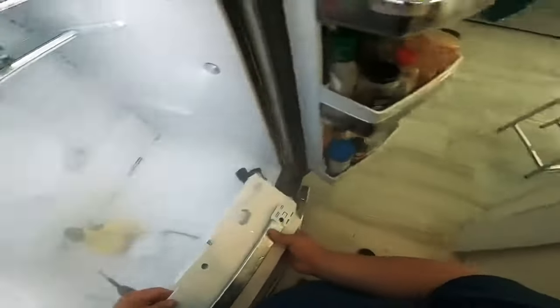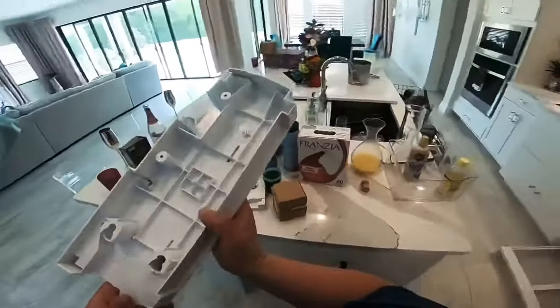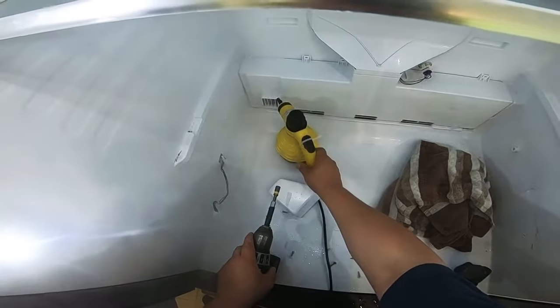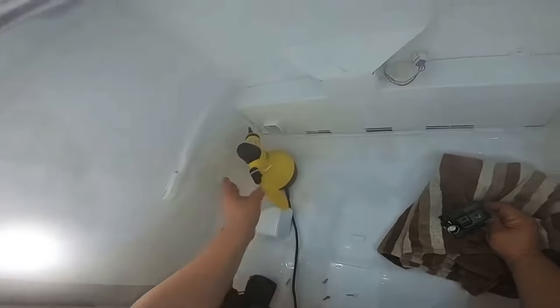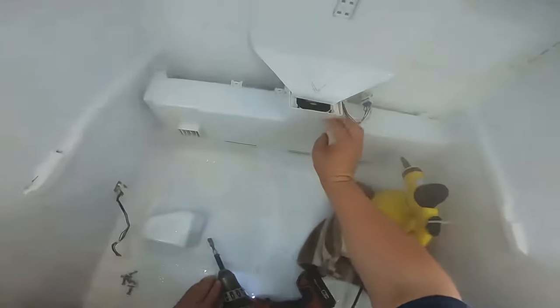Put the steamer right on it to defrost the ice. Be prepared for water to spill because you are melting ice. If you have water sitting in the bottom — like a block of ice — this video can help you fix that issue too, because that means you have a clogged drain line. I have multiple videos about unclogging the drain on this model. This is the last screw — it's a total of six screws.